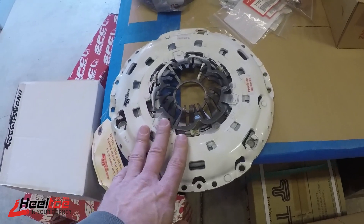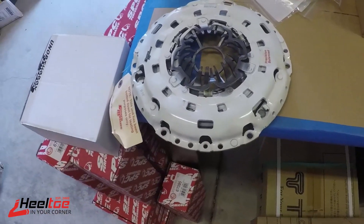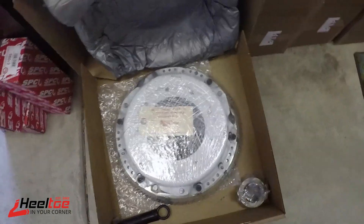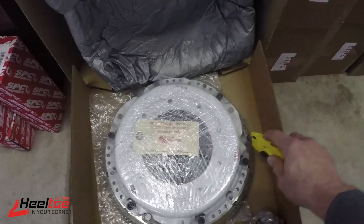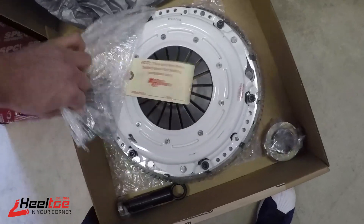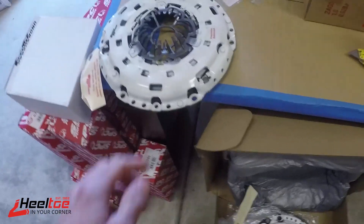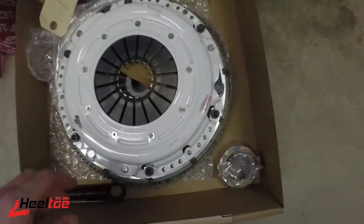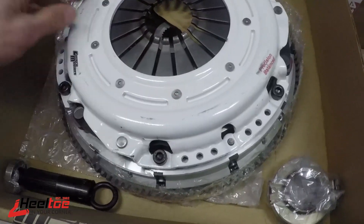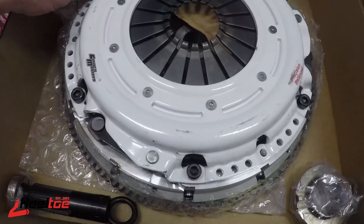Part of the reason these clutches are problematic in the aftermarket is because you can't really modify these self-adjusting pressure plates very well. Clutch Masters has been doing it for a while but they've been unreliable at best from what we hear — though there are a lot of installation issues too. What they tried to do is absolve some of this by going to a different style pressure plate: a non-self-adjusting, more conventional style where people don't have to worry about whether their pressure plate is adjusted correctly. This is their newer style — and believe it or not they actually retained the same part numbers. This one is 08040 and this is 08028. You can see this one is a much more conventional design with none of the self-adjusting involved.